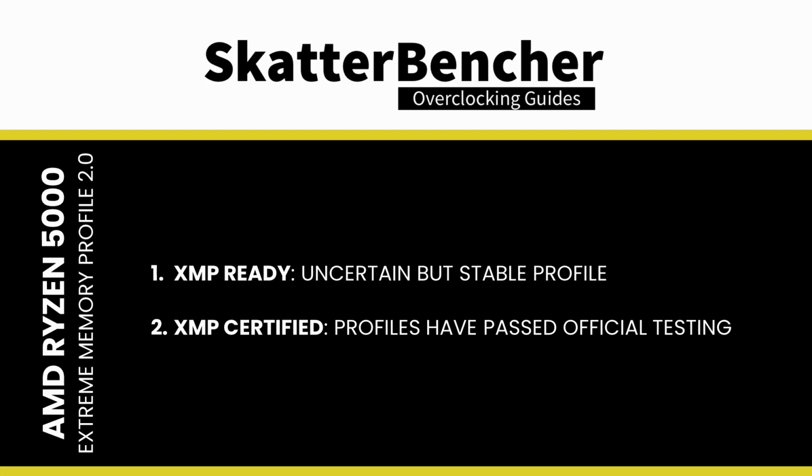There are two types of XMP certification. XMP Ready, where the module was programmed with an uncertain but stable profile, and XMP Certified, where the module was programmed with settings that have passed the supplier tests for the CPU and motherboard. I almost always run XMP on my systems because it's an incredibly easy way to get a little bit more performance. Do note that some motherboards might increase the CPU memory controller voltages to get really high frequencies stable.